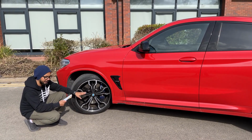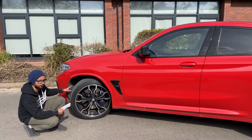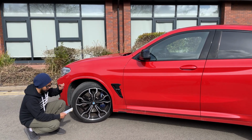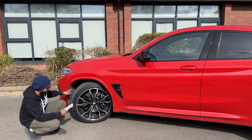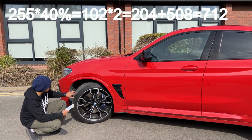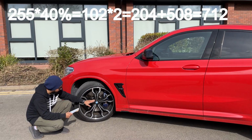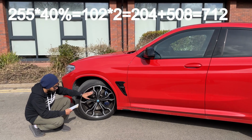So if I go for the 20-inch wheel, and if I want to stick to a similar width of the wheel, which is 255, I can go for 255, 20 inch and 40 sidewall. If I do that, you will see the calculation. So now the width stays the same, 255, and my sidewall portion is still the same, 40%. So 255 times 40% times 2 is equal to 204, but my wheel size changes, which is 20 inch, so that will drop from 533.4 to 508.